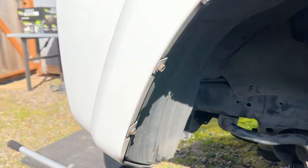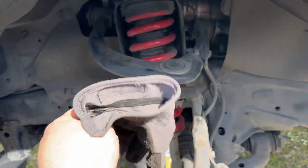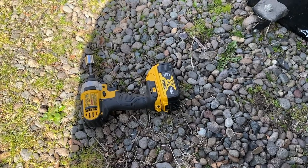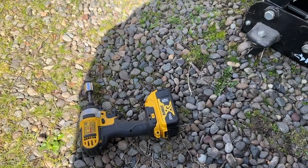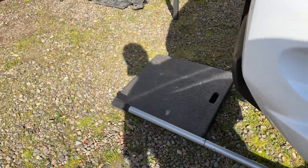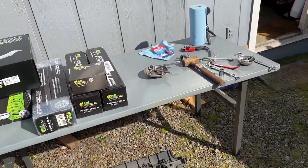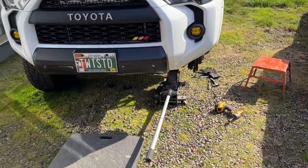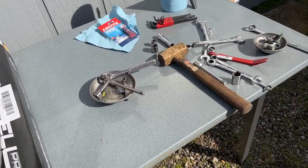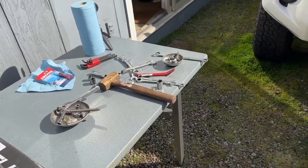Let me share a couple tips I've always done. Gloves — these are worn out with holes in the fingers, I've had them a long time, but I just don't want to give them up yet. I have a cordless impact gun, just a 20-volt, which doesn't necessarily break things loose, so I like to use a breaker bar or half-inch drive to break things loose and then use the impact to finish it off. This mat for laying down on the gravel is key. I also keep a table with all my tools organized — I put them back after each task so I'm not hunting for tools. And these magnetic trays from Harbor Freight — a buck or two — are invaluable for keeping hardware.